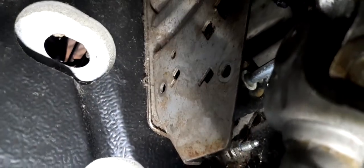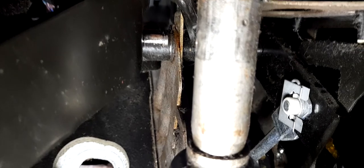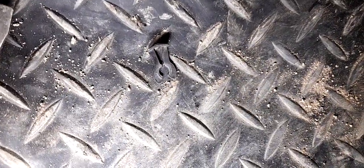In the car, you remove this plastic trim panel here and then come under here — it sits up on that plate. There's a hole there where the pipe goes through, and then there's another hole up here where the pipe comes through for the feed from the master cylinder. There's the end of the shaft. On there is that clip — just pop it off with a screwdriver and you can get the master cylinder off. Then you have these two bolts which come through from this side; it's a bit of a wiggle because you have to get that back bolt.